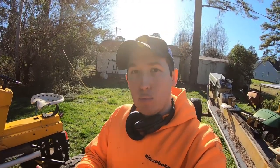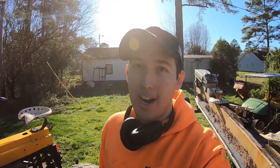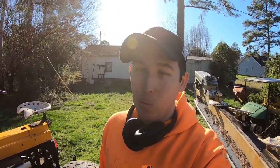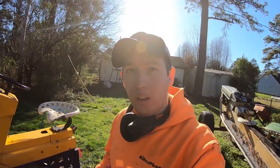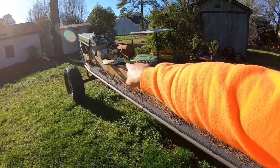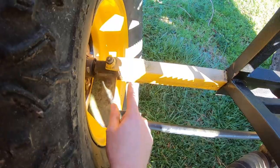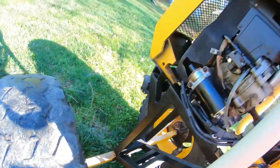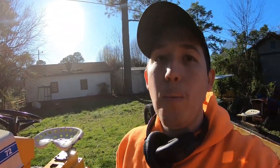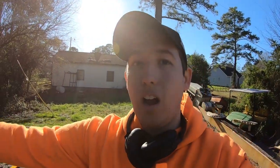What would end up happening is as we would turn, one tire would lay in further than the other. And when you're trying to push a tire around a corner, it doesn't steer well. Go figure. We learned a little trick that I'm going to actually show you with this build right here. It basically involves some string, kingpins, and a differential. After my trick, we got my steering geometry correct. This thing turns so much easier now. It's crazy. I can turn it one-handed on concrete.